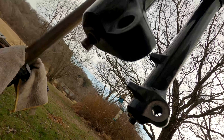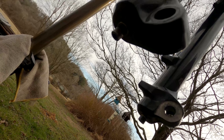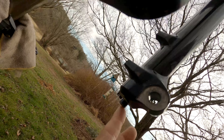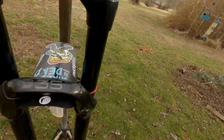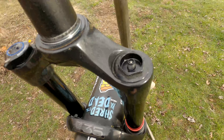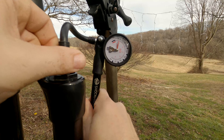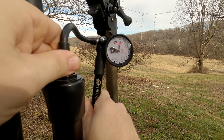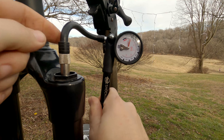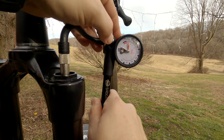You want to make sure your rebound is set all the way on the fast setting. I stuck a tiny allen key up there and rotated it — it's 14 or 15 clicks out. Then we're going to take another allen key and loosen these two bolts on each side. We're also going to take the cap off here and take a reading of the pressure in there right now, then let all the air out. Looks like I'm at about 61, 62 psi. Okay, now let's start letting the air out.